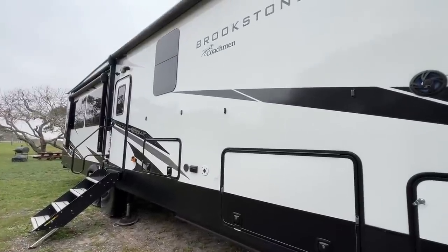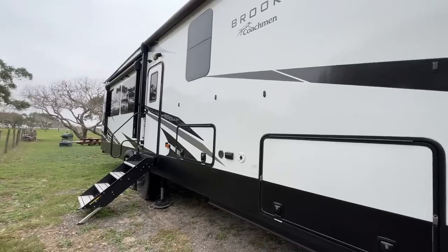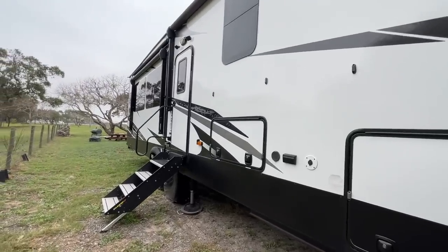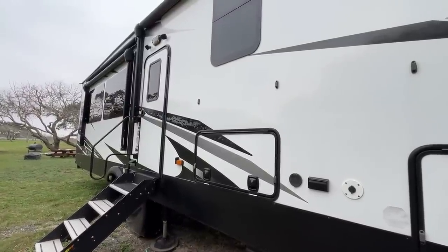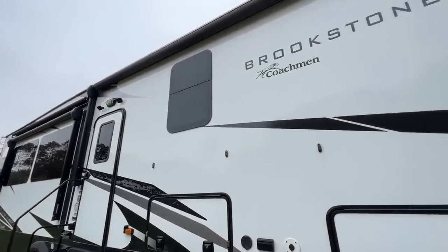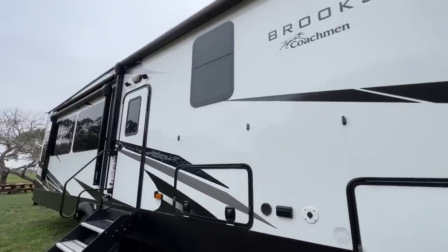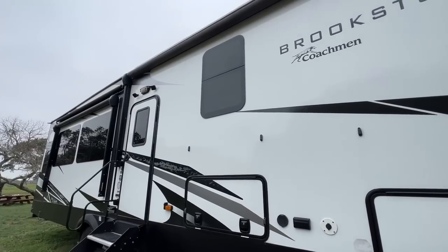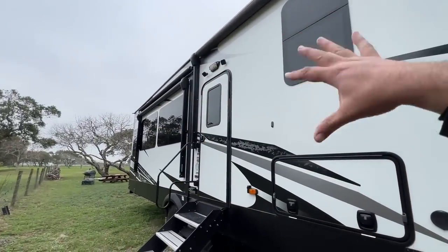You can't just hit the side with the pressure sprayer, get everything off, and call it a day. You really have to be careful because there are a lot of ways water can get into your RV and even into the sidewall if you're not careful. The first thing you always want to do is spray the outside down very softly — put it on the shower feature and give your RV a shower bath, but don't spray directly at or under the windows. Arch the water over and let it drip down.